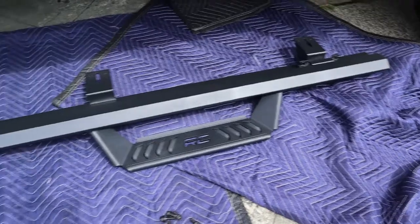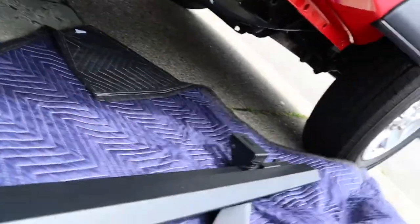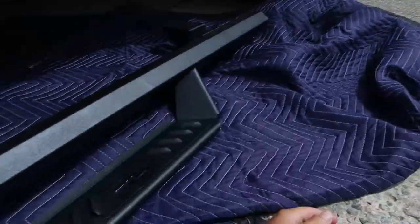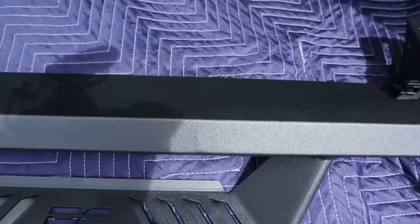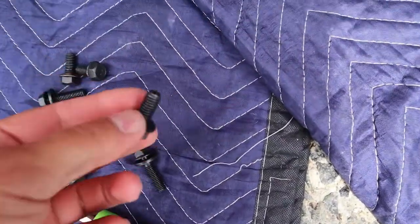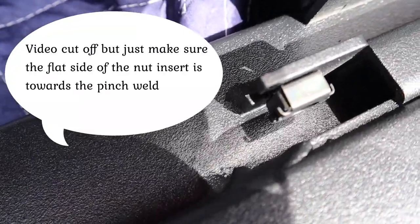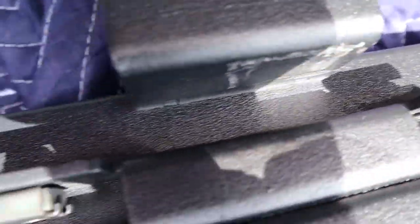Here's the sidestep itself. You can see the three holes where the bolts are going to mount. Underneath the side, there's one in the front, one in the middle, and one in the back. The nutserts that were put in are going to go behind the pinch weld — that's where the other bolts will go. There are two different size bolts: the longer ones are for the holes in the body, the shorter ones are for the nutsert install. Just make sure the thicker side of the nutsert is towards the back, and this slot is where it slides into the pinch weld.